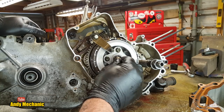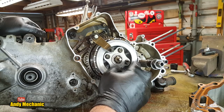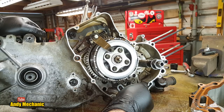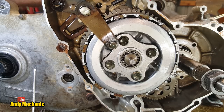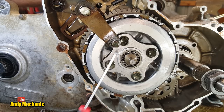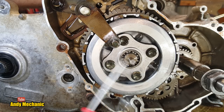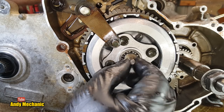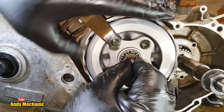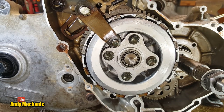Okay, so when that's pushed on there, it releases the pressure on this pressure plate, and then the clutch can slip. I wonder if we can maybe replicate that. We could give it a go. As the rider moves the gear lever, which causes this little lever here to move, that causes the mechanism we looked at with the three ball bearings to apply a force onto the end of this rod here, look. This rod sits in a bearing, because all this is spinning around. This will be stationary, and of course the clutch is whizzing around really fast as the engine's running.